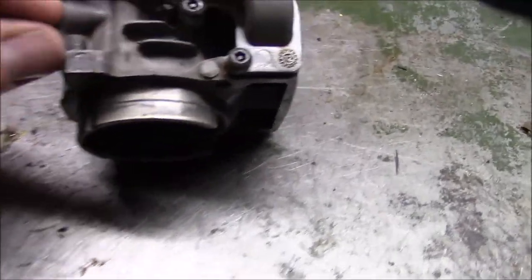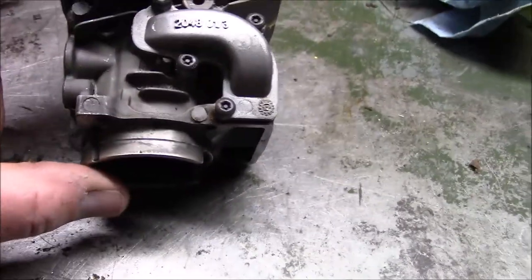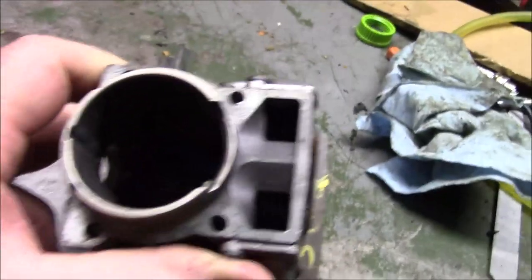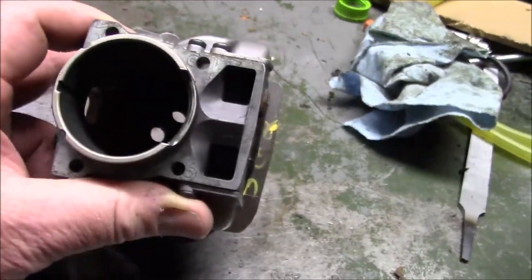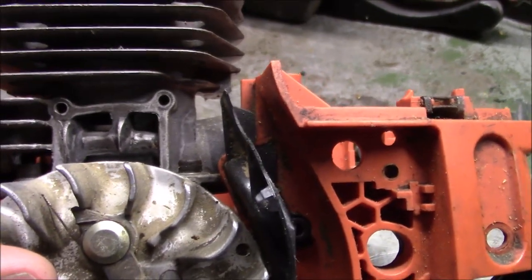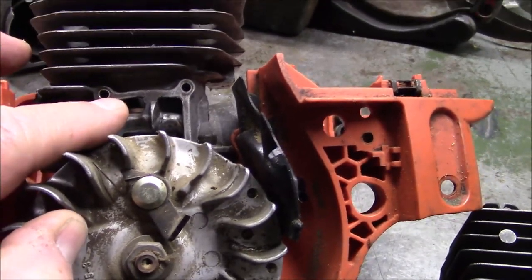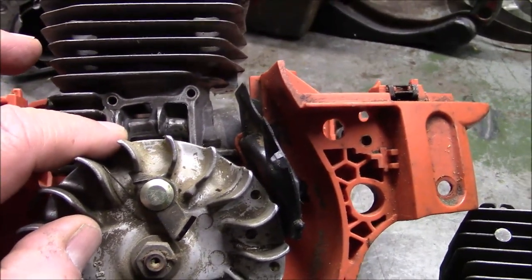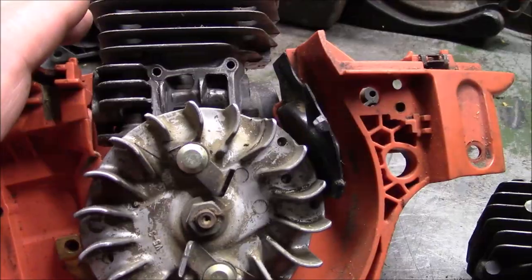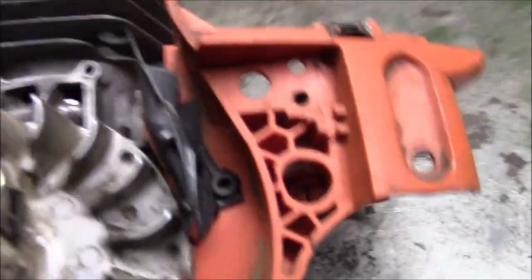But I always get nervous about reducing that thickness there. I mean, you drop 40 thousandths, that's quite a difference. And the pop-up concept that I do, theoretically it's not as good, but it does make a difference. You don't get quite as much of that interference with the piston, so I don't have to go quite as crazy with the roof of the transfers to get the cross-section area back. And yeah, there are other things that are not theoretically optimal with the pop-up concept.